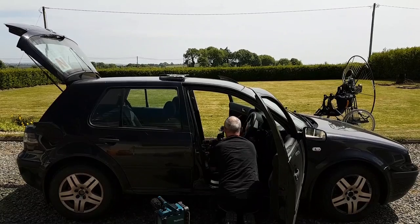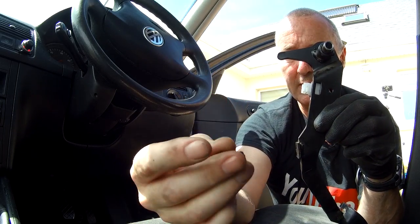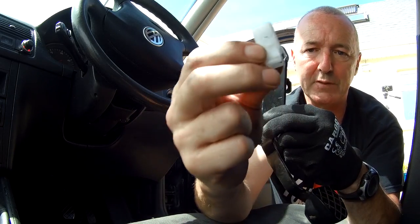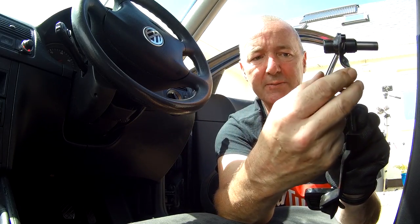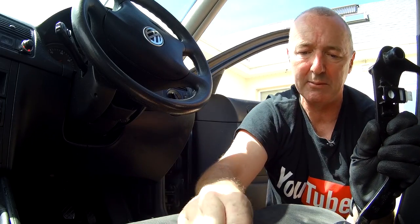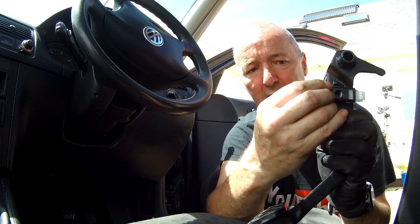Okay, so this is my clutch pedal. Goes on like this. It's got a roller. Roller goes in here. It's like a bushing, a bearing if you like. This little white thing holds a push rod in there and holds it in place. This pushes in here. The problem here is the whole assembly pushed through the back because the back of the socket broke off. So I'm going to weld that back on here now.